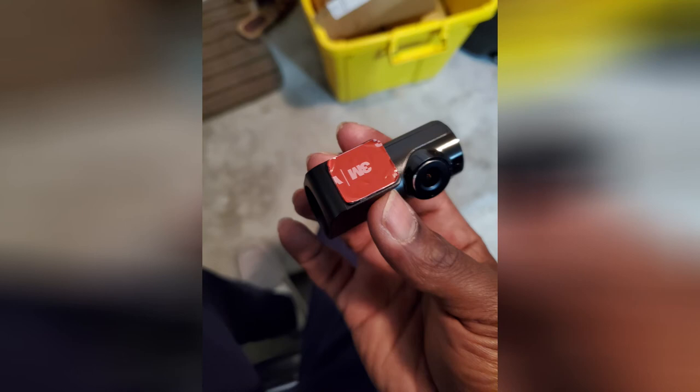Now it is time to install the rear camera. Take note: the rear camera has a very lengthy cable. If you have an SUV, I highly suggest starting in the front first with the cable because you can always tuck excess in the back hatch area. If you have a car, start from the back first, because you'll have so much cable left over you'll probably need to tuck it somewhere underneath the dash.